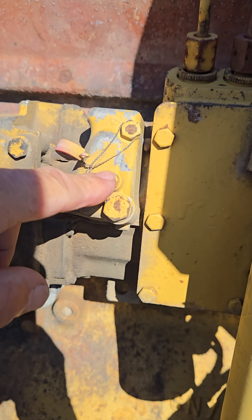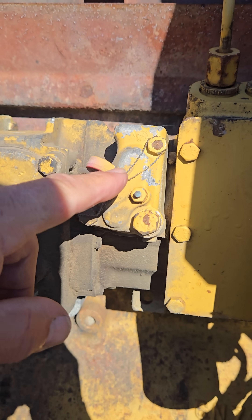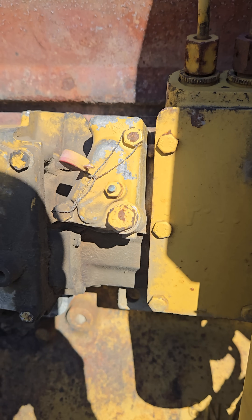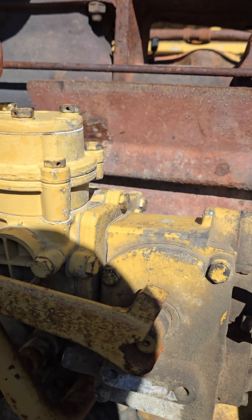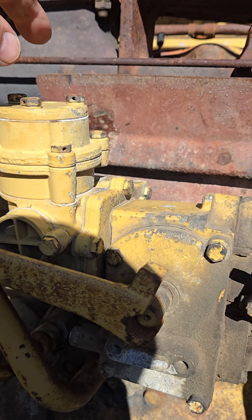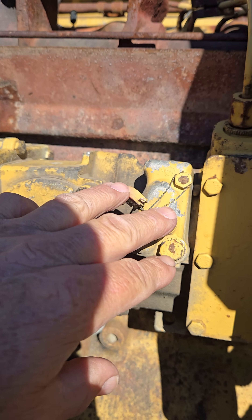You're going to put a test light on this and hook the other end to a power source, then put it under full load. Under full load, that should make continuity with the rack and your test light should turn on. If it doesn't, take these bolts off — you should be able to turn this cover, which is going to turn the adjusting screw for the air-fuel ratio. Turn it down one turn, bolt this all back on so you're not losing boost, and check it again.